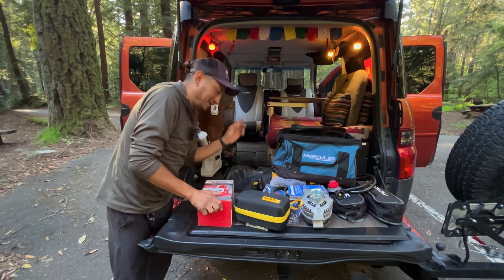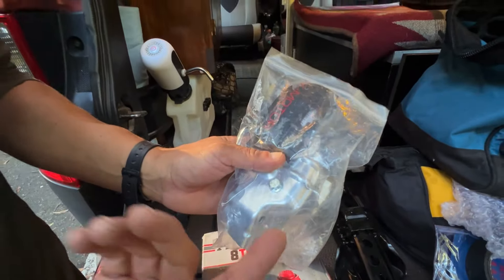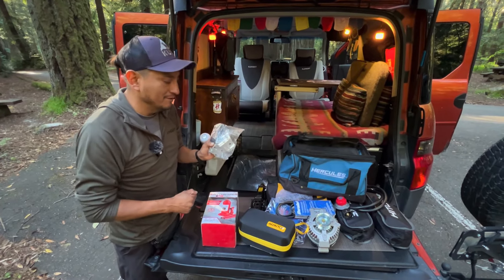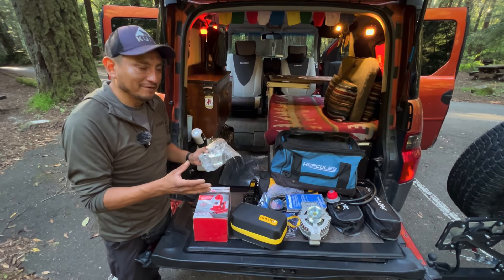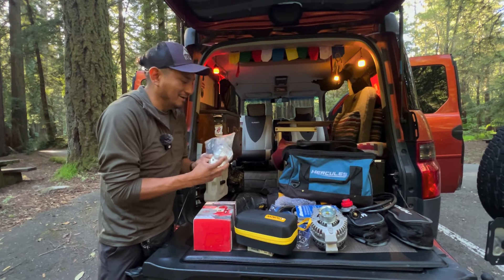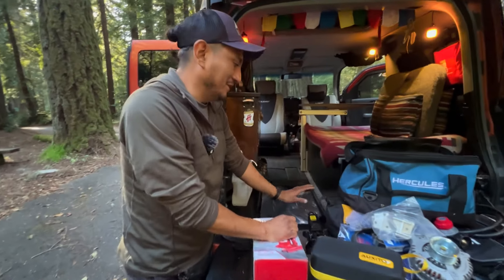This is like a magician's hat — I just keep pulling things out. This is a VTEC solenoid, brand new in the box, with a pair of connectors because a lot of people have problems with the connectors. I've already used three of these: one for my own Element and two to save other Element owners who were camping near me — I drove out to them and fixed their VTEC problem. This is a must-have when you own an Element and you're traveling.